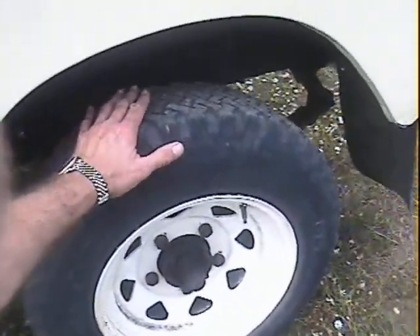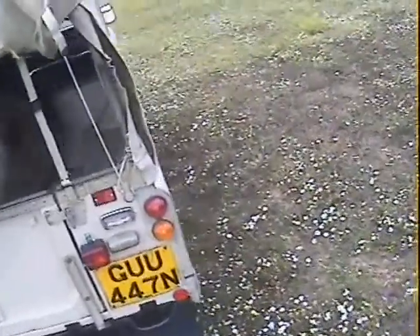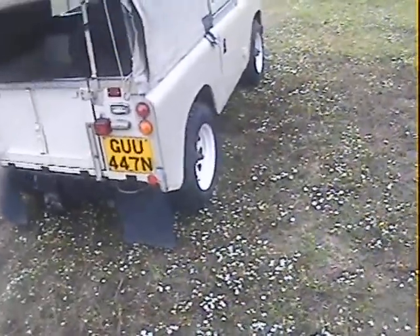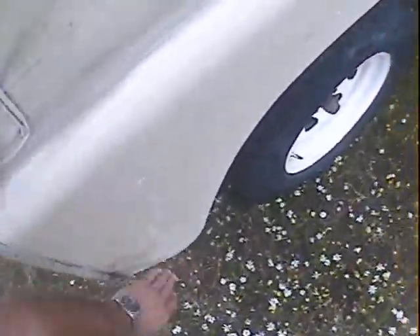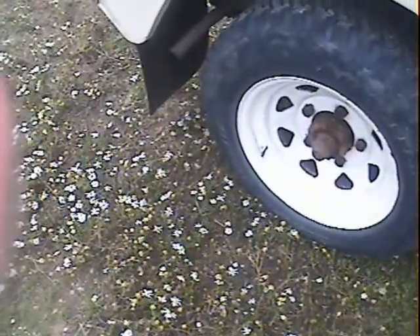Just having a little look under the tail end — it looks like it's had at least a new rear quarter chassis fitted to it; you can see a bit of a join there as you should. Carrying on around it down the offside, pretty much the same story really — crinkled modesty covers, a bit of crinkling around the back of the offside rear wing and a bit of crinkling and denting up here. But all nice, correct, honest and good. It's definitely had a new rear quarter chassis.